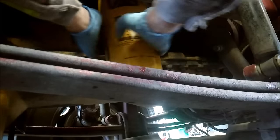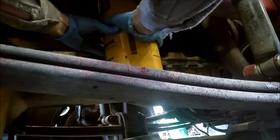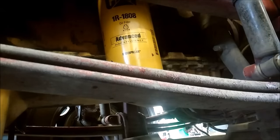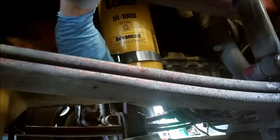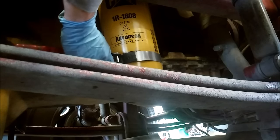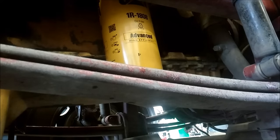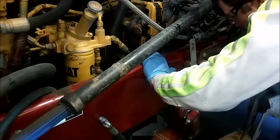What's the proper torque for an oil filter? CAT recommends that once it stops, you take it a full turn. It has dash marks with numbers — we stopped around one when we just spun it on, so we need to take it all the way to the other one. I don't typically go by the dash marks; what I do is put it on hand tight, about as tight as I can get it with my bare hands, and then take it three small turns with the strap wrench. You'll see we're back at one — so that works as a little trick. Then you mark it with the date, mileage, and your initials. And then we're going to move on to the fuel filters.